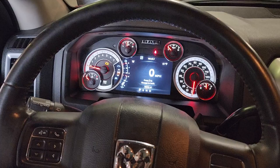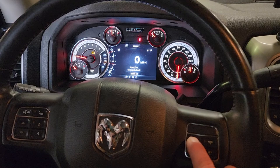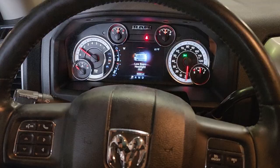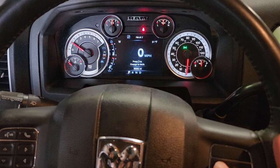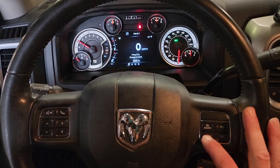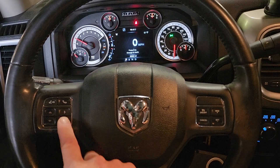Cruise control on/off - the one my brother said wasn't working. I don't see any data that shows me that pushing the on/off cruise control button is doing anything. Let's start the truck. I got a low beam out message matching the code. Pressing the cruise on/off and the cancel button - I don't see any changes.